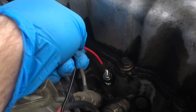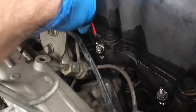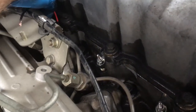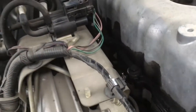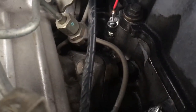You'll see we get a spark on all of them now. It's not a great big spark like what you'd get if you touched straight to earth — which we wouldn't want to do anyway — because there's a fair bit of resistance in those glow plugs. But all four of them now have a little spark. Normally you wouldn't need to check new plugs, but we're just showing you so you can see what good plugs look like.